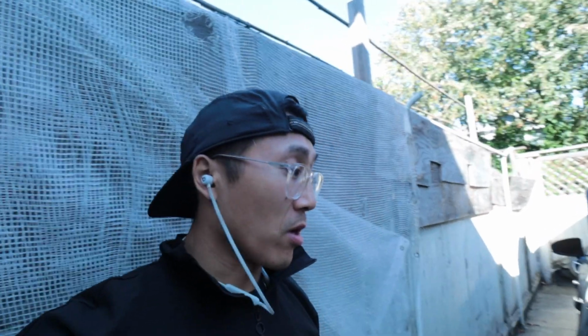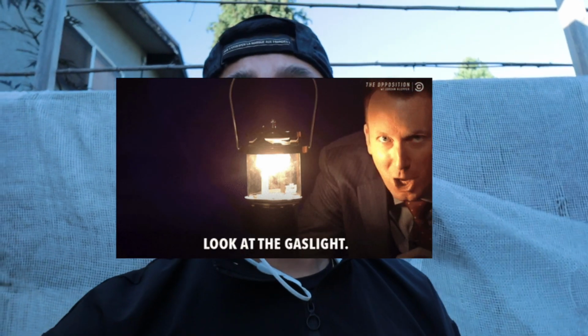I know this video was like all over the place, but those wheel bearings were no joke to take off the car. The whole reason I'm changing out the wheel bearings in the first place is if you go over like 60 kilometers an hour, the driver's side wheel starts whirring. Like the road noise is crazy. My wife said there was like vibrations at like 80 kilometers an hour, but I didn't feel it.